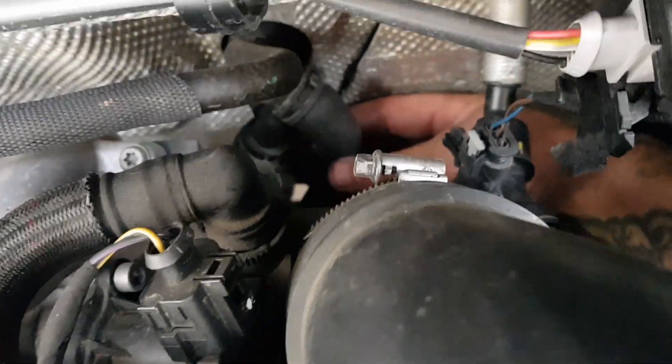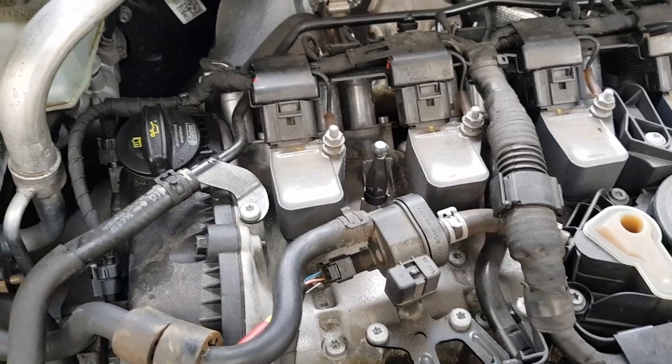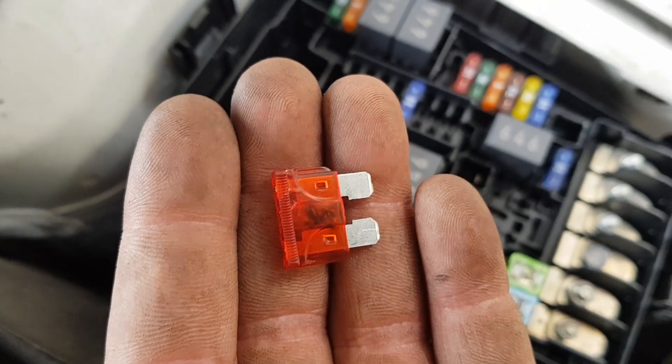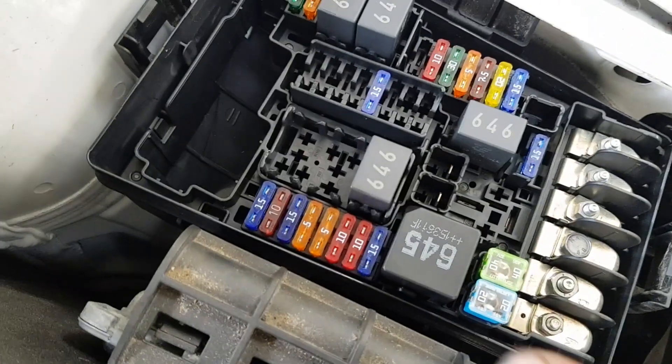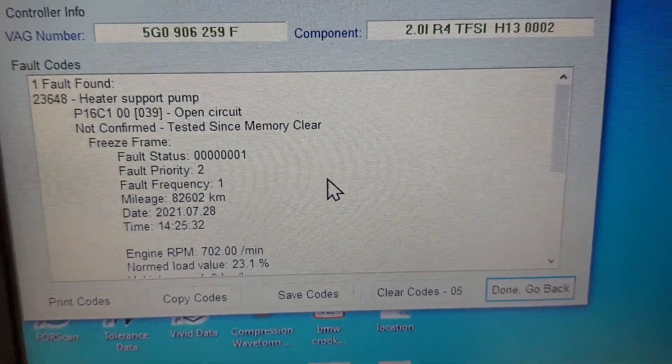I'm going to go find this coolant pump, wherever that lives. I'm guessing it's different than the Mark 7 the other day because that was a diesel one. So I found this heater pump — it's down the back of the engine. You can see the heater matrix pipes here; if you follow them down, they go into a pump at the back. It's got a little heat-proof cover around it and you can disconnect the wire off of it. I disconnected the wire and that said open circuit as well, but the other codes didn't go away. What I didn't account for was, of course, being a short to ground, I was going to get a blown fuse. So put a fuse back in — we've got battery voltage on our evap. I cleared all the codes and apart from open circuit on that heater pump, the rest have gone away and don't come back.